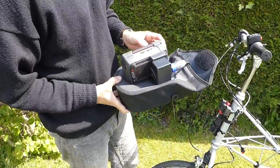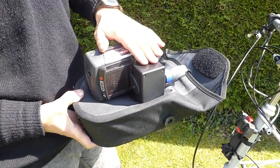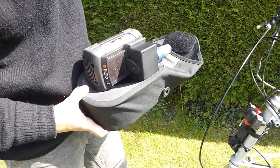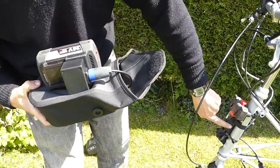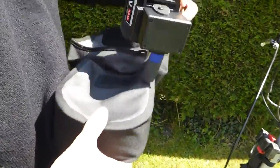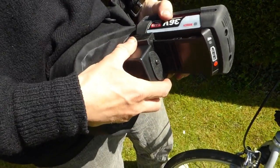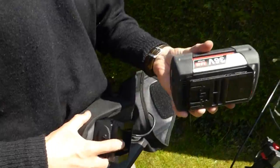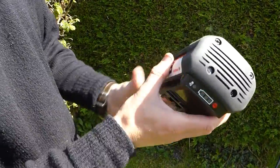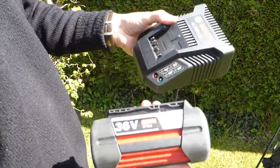The battery itself in the bag is mounted on nano's own adaptive electronics, which allows the battery to power the system. The controller itself is back down on the frame, discreetly hidden away on the head tube. If you want to take the battery off for charging, it's a simple matter just to slide it off the adapter — it's a 36-volt, 4 amp-hour battery giving you 144 watt-hours of power.